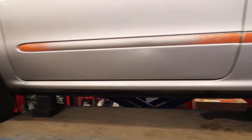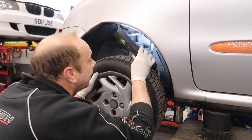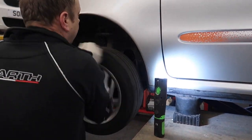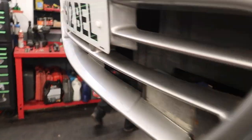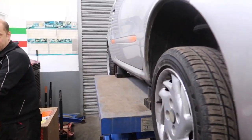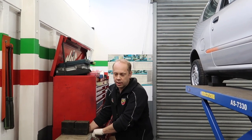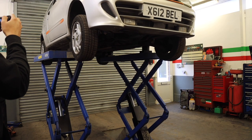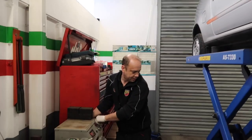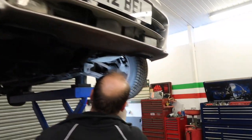I have been advised that both of the wheel cylinders are binding. I don't think it's that — it looks like the pivot points on the rear brake shoes are seized. It's quite common. Because the cylinders do suffer from seizure, but those arms I've already seen — they've pulled right in. So there's a pretty good chance that's all it is. But the handbrakes are pretty poor on these anyway — the handbrake on this is rubbish. From day one they were like that. I've tried to adjust it and yeah, it's awful. The handbrake may as well not be there.